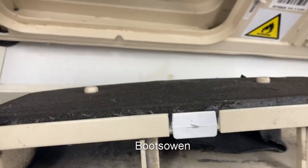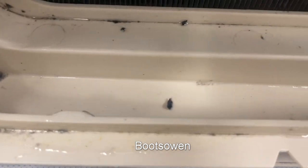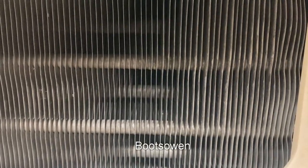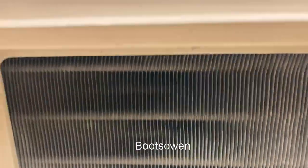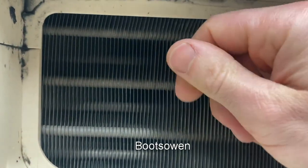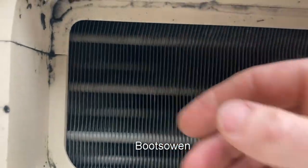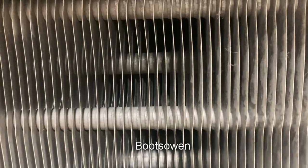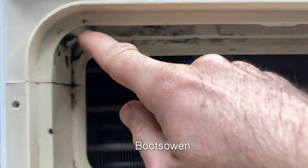Let's bring that over to the sink and give it a clean. If in here was full of fluff it would be worth cleaning it out, but as it stands it's actually quite clean. And if those fins there are covered in fluff, you need to clean them somehow. Get a gentle brush — something like a toothbrush — and try to flick the lint out towards yourself. As it stands, that's all really spotlessly clean in there, and the filters appear to be doing their job. I'll give this a wipe out before I put it back together.